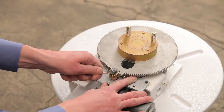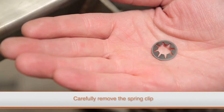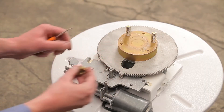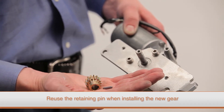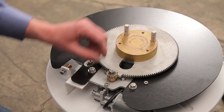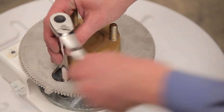To replace the small gear, remove the spring clip on the top of the gear using a small flat blade screwdriver to work the clip off the motor shaft. With the clip removed, pull up on the gear to remove it. Make sure to keep the retaining pin that locks the gear on the motor shaft as it will need to be reused when replacing the gear. If the large gear is damaged, then the hub assembly needs to be replaced. To remove the hub assembly, the motor assembly must first be removed. Refer to previous steps regarding removal of the motor assembly.